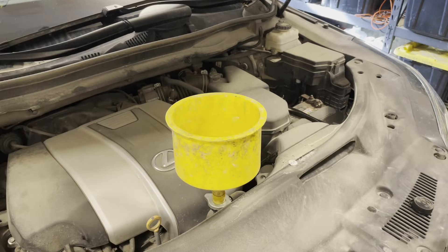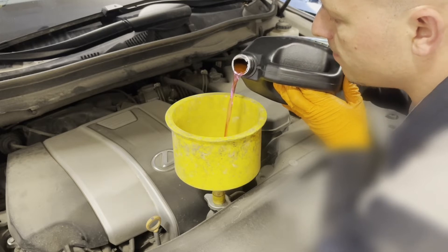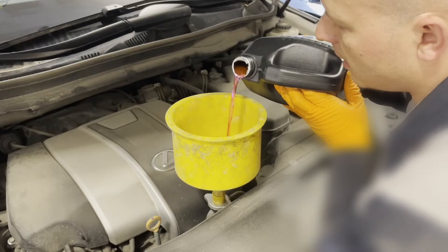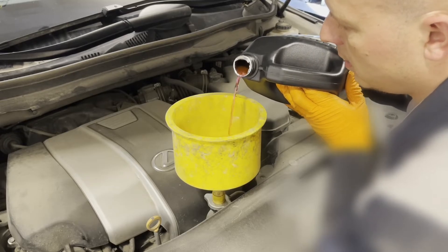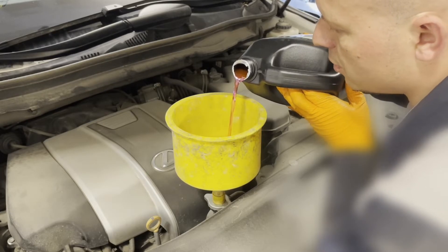When you're filling it, it's important to fill it nice and slow, because if you fill it very fast it's easier to get an airlock. So just take your time, don't rush it. Keep filling it until the radiator and the engine block are full and there is coolant standing in the funnel. It will take a couple of minutes to do this with a nice slow stream.